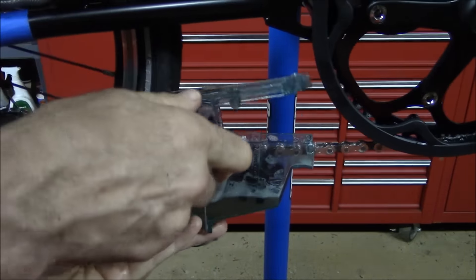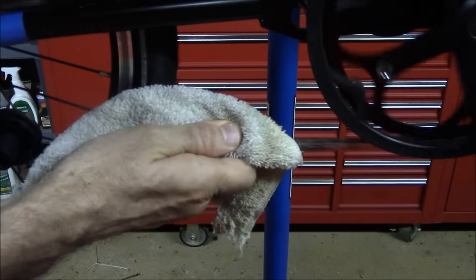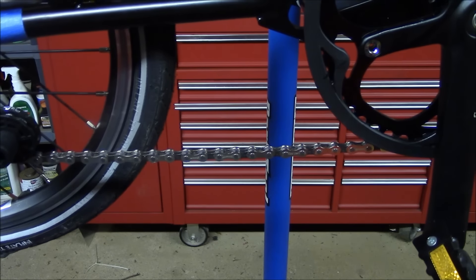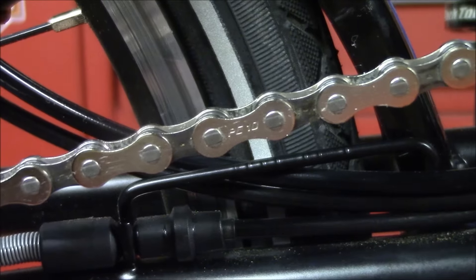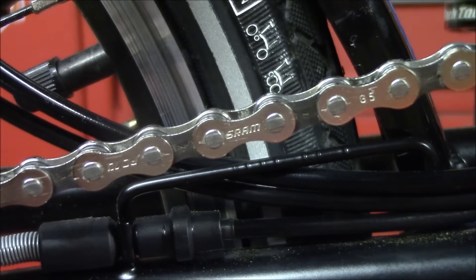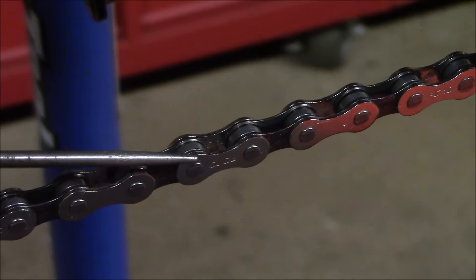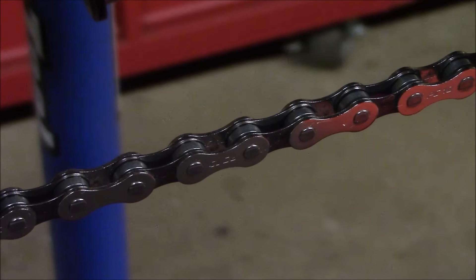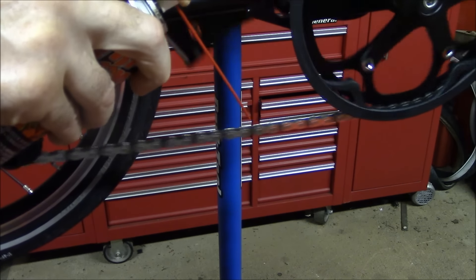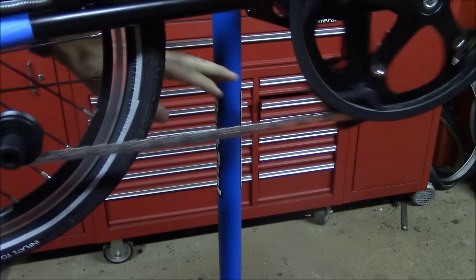And that's enough. Then take a rag and just wipe the chain down. Let it dry, and then we'll lubricate the chain. Now you can see just how clean the chain is — it's ready to add the lubricant. When I lubricate a bicycle chain, I lubricate the inside of the chain and each side, with each side getting one full rotation of the chain. To lubricate the chain, I'll be using Tri-Flow in an aerosol can. And that's it.